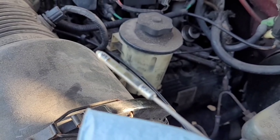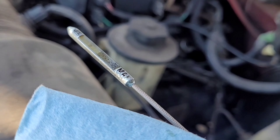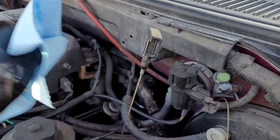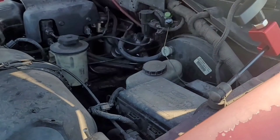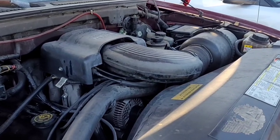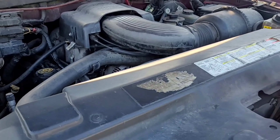Alright, turn off the vehicle. Looking at the dipstick with a piece of paper — this looks good, just a slight tad over, probably because some oil is left in the galleys and inside the pan, but besides that it should be fine. Put the dipstick back in. We used all six quarts and got everything done. Hope this video was helpful — if you have any suggestions or tips, leave them in the comments below.